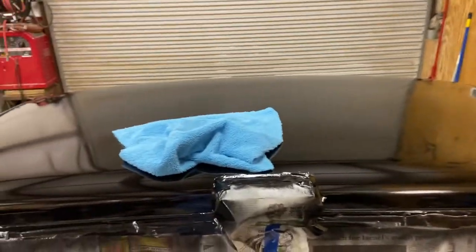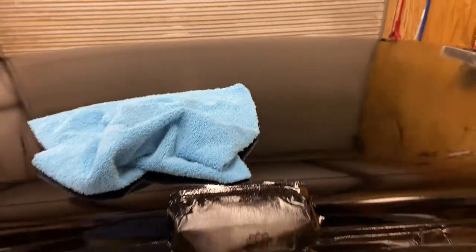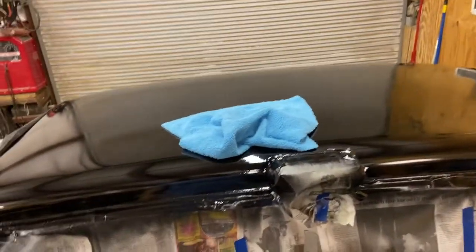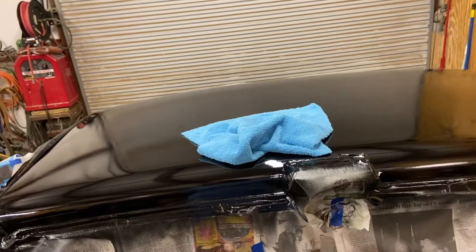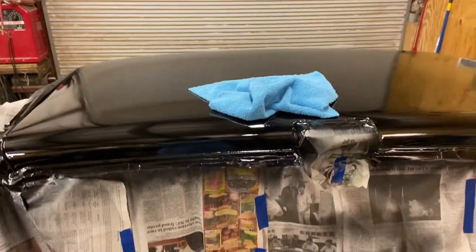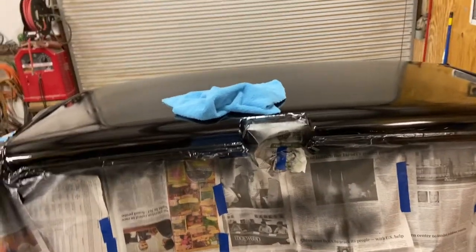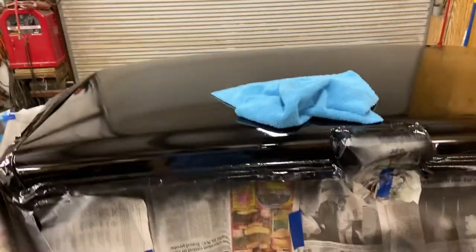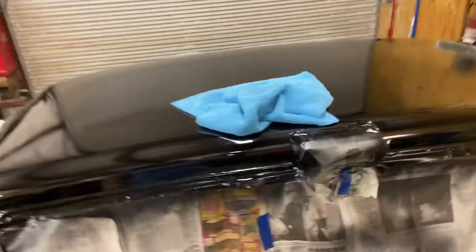But also, quick tip for anyone doing this, I did this on a similar truck. I painted another truck roof black. It was literally the same setup, an OBS Chevy, except this one was a 1500 gasser. But I rushed it. I ended up doing the black and the clear coat without giving the black enough time to dry, and then the clear coat bubbled up. I rushed because I was in a hurry because I had to work on the blue truck, and the truck I was painting was in the shop, so I really rushed it. So, quick tip, if you're painting the roof of your truck black and doing a rattle can job like us, make sure you give the color coat plenty of time to dry before you put on the clear coat.